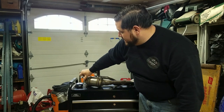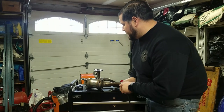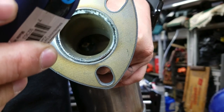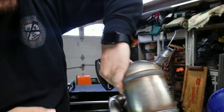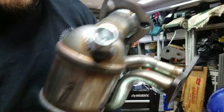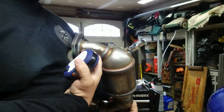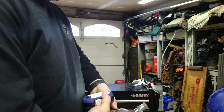Hoping I don't. If you do, on eBay they make 90-degree ones you can use which will do the same thing. One key thing — if you look in there, you can see the O2 sensor boss threads. And if you look a little closer, you can see the tip of the fouler. There's still a hole in that, and it will still flow exhaust gases through the foulers and let my air-fuel ratio read the proper readings that it needs to adjust for. It will read a little cleaner — that's the whole point of me trying to run this system.